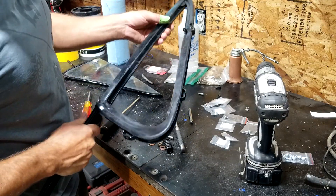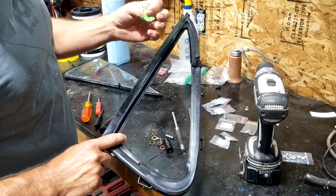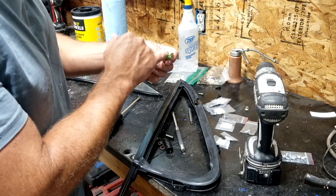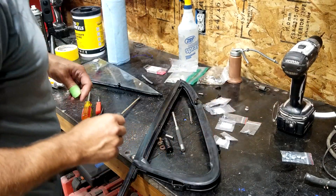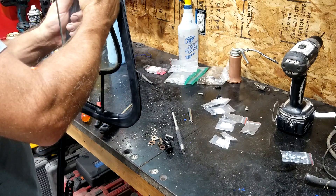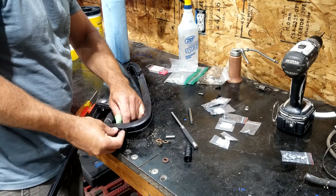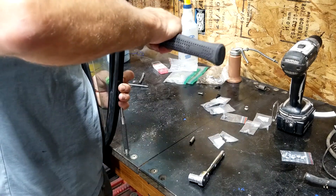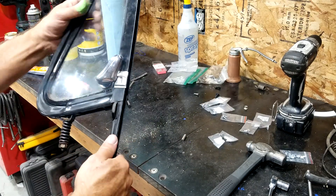The weather stripping is properly stuck to the frame, all dried, and my thumb is all patched up. I don't know how deep that drill bit went and I don't think I want to know, but it throbbed all night and I can feel where it would have come out if it had kept going. A little too friendly with that bit. I want to put this thing back together and then it should be ready to go in the truck. Shaft goes through, not all the way. The shaped washer on — that's the one that controls how much it will open — then a washer and the retainer and the nut. I believe that vent window is ready to go back into the door. It took a piece of flesh with it but it's ready.